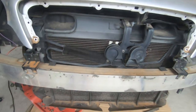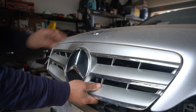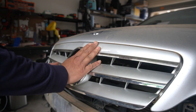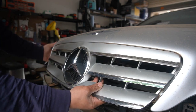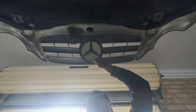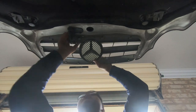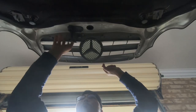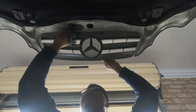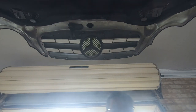We're going to reinstall our front grille and that's it. Make sure it all lines up and sit it in nice and flush. Before you tighten the front grille back on, ensure that the bonnet release lever is sitting in the first gap of your grille — it has to be in that first space. Once you've confirmed that, reinstall your screws and you are pretty much done.